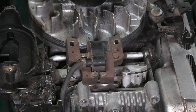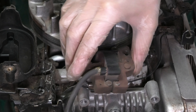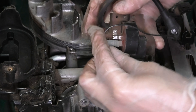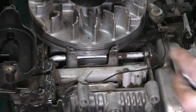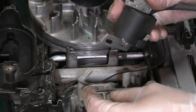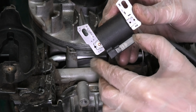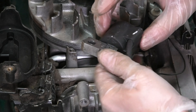For now I'm going to remove the old ignition coil. I want to be careful when we remove it — there's still the wire attached to it. Now I have my new ignition coil, which pretty much looks almost the same. Don't forget to reconnect the kill switch wire here — it's really important that you do that, don't forget to do this.